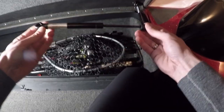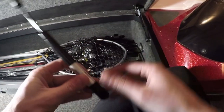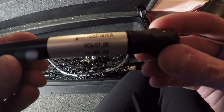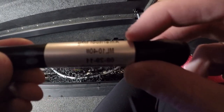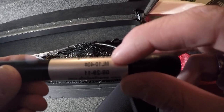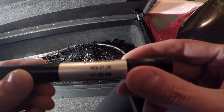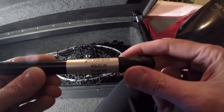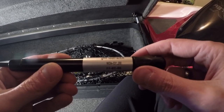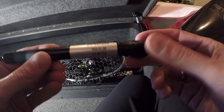This is the gas spring or the strut. Most of these will have some sort of model number on them. This one is Ameritool Manufacturing, model number ML10-40lb, meaning this particular strut or cylinder has 40 lbs of pressure. I went ahead and upgraded to 60 lbs so that I don't have this problem again.